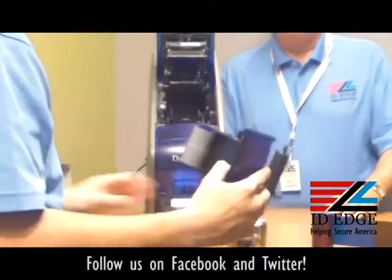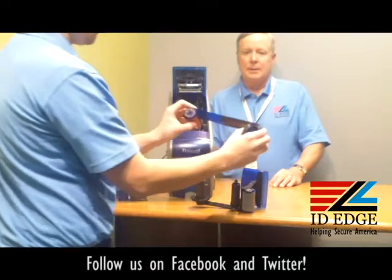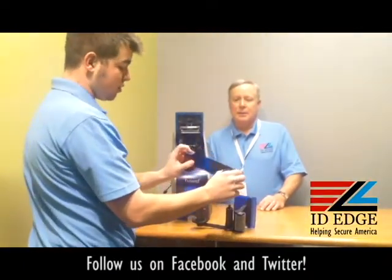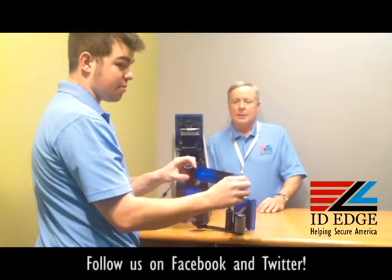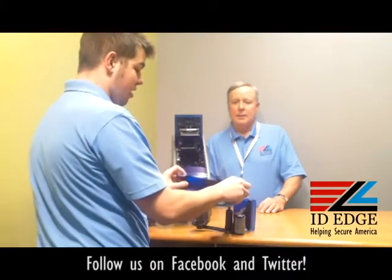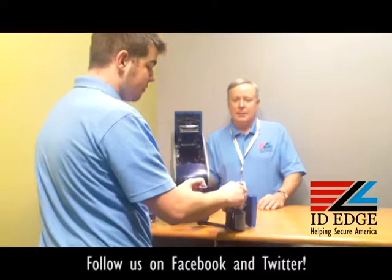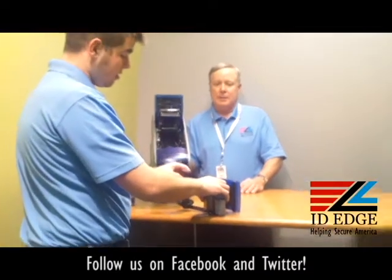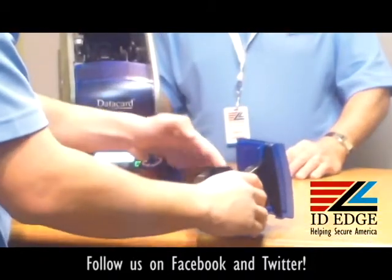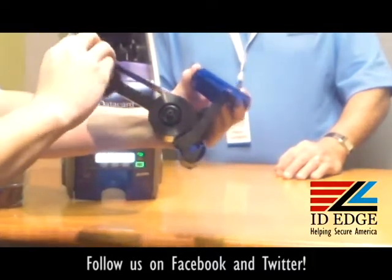When loading the ribbon, just set it down and you'll see from the front you have a large hole and a little hole. The large hole will go on the right and the little hole will go on the left when entering it properly. The ribbon will go over the top. When entering it, I always roll it up a little bit, put in the right side first and make sure it clicks. After that, put in the left side and make sure it clicks. Through that hole, you'll see the rod that comes out on both sides and you should be able to spin it.